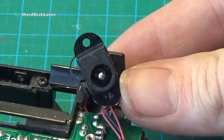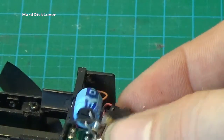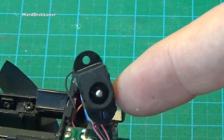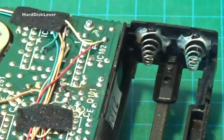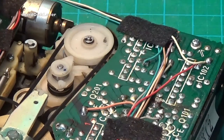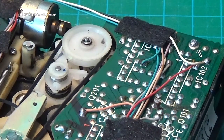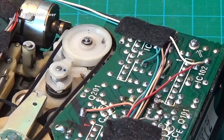I have found the issue why it's not working. Normally, if you have a plug like this, the pin in the middle is positive and the shielding around it is negative. But if we take a look at the capacitor in here and its polarity, you can see that it's exactly the opposite. Sony, why did you do this? I mean, I know they want you to buy the custom power supply, but come on. Let's flip the polarity around — that's definitely the reason why it was not working. Let's see what happens. Let's take a look at the motor again. I press play and watch the current it's using. There we go — we are pulling 60mA, and that does seem correct. I can assure you that motor is moving. It does seem like everything is still functional.